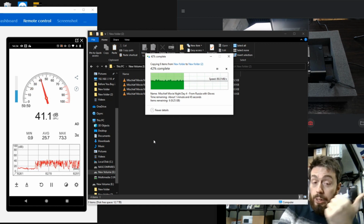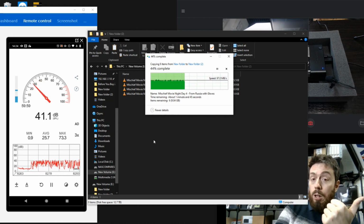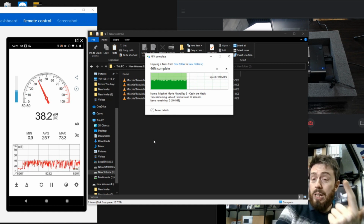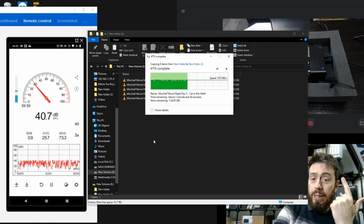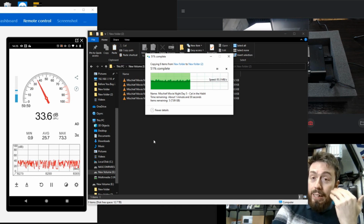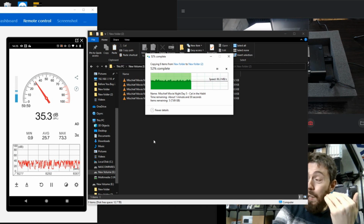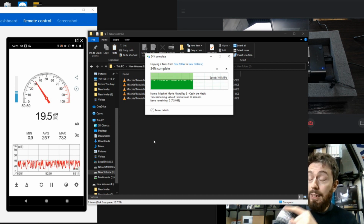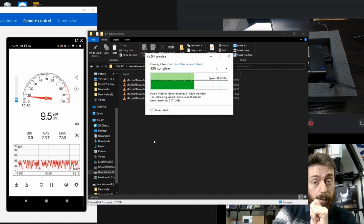So when it comes to the larger capacities of desktop hard drives and the larger capacity of single-use hard drives, it has to be borne in mind that even when you see enclosures that are one or two bay, that say they have 2x18 TB drives, if you're using it in DAS, chances are you're gonna be 1 or 2 meters away. So chances are noises like this are gonna be noticeable. Let's listen to it a bit more.